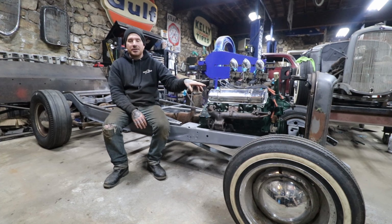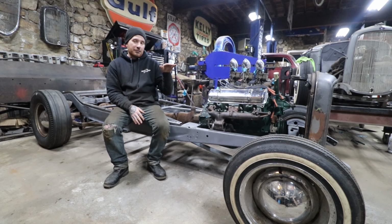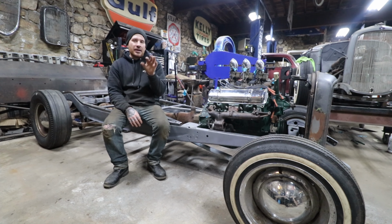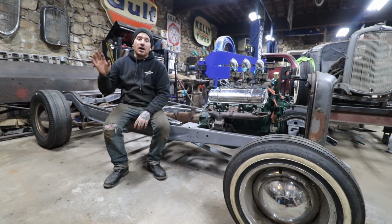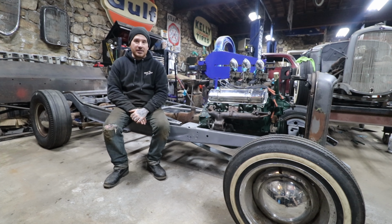I had to just basically put another little rubber spacer in the front, rubber motor mount on top of the biscuit mount to get the top front of the engine up a little bit. And it's right in the ballpark. I got the bubble level on the center carb, and half the bubble's in the center, pretty darn close. But we have to remember that we're going to be putting a body back on here. We're going to be putting a gas tank, interior, all that stuff in the car that's going to actually drop the rear end just a little bit. So I think it'll be okay. It's right in the ballpark.